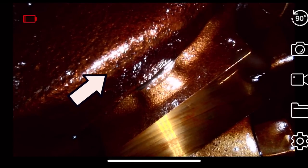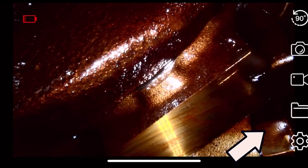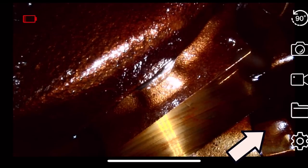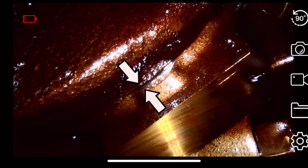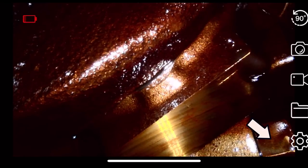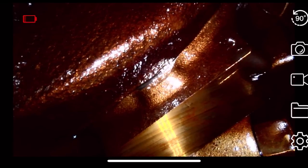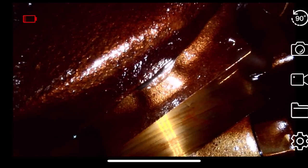What I want you guys to pay attention to is this: the arrow is the crank itself, this is the rod in question, and over here is another connecting rod that's actually moving when I turn the crank. You'll notice — pay attention right here — I'm rotating the crank back and forth, but that rod is not moving with it. There's play in that rod. If you look at this other rod, it moves whenever I move the crank. But looking at the problem rod, the crank moves but the rod doesn't, and you can see the play right there.